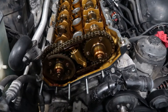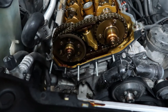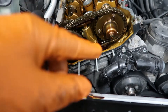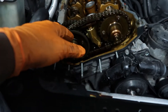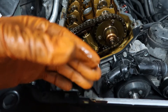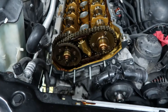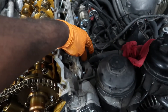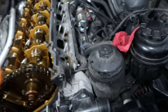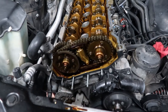The VANOS unit is off. As you guys saw, I had to pull off the front cover, the cap, and then deal with the left-hand thread — I had to tighten in order to remove it. I'm going to leave all this other stuff in here and just pull them off as-is, then try to get the head bolts out. I'll make sure I film this part. He's still working on the manifold down there, so we should be good soon. I also have to take off this coolant line, which is definitely going to break — so I already know I'll need to order that.